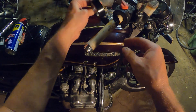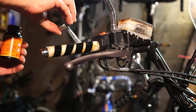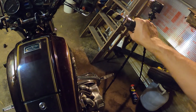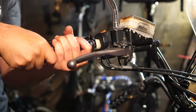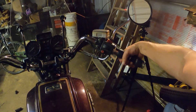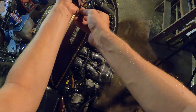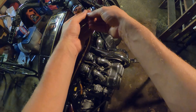Then I covered it with electrical tape — you only want to cover the plastic sleeve itself. You can see there was a metal tip at the end of the handlebar; you don't want to put tape on that and you don't want to get rubber cement on it either. Once I had the rubber cement on the throttle sleeve, I twisted on the new hand grip onto the throttle side. Then I got on the bike and, while the rubber cement was still tacky enough to move it around, I positioned the hand grips how I felt I was going to like them most.